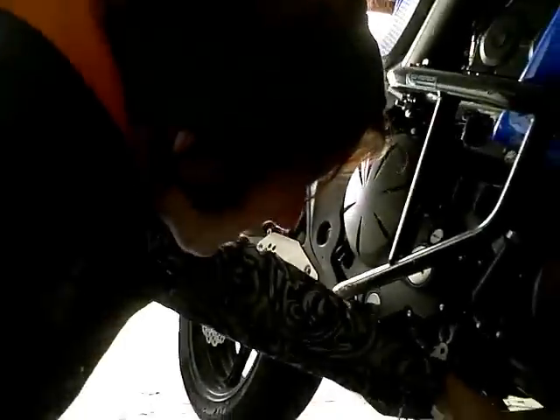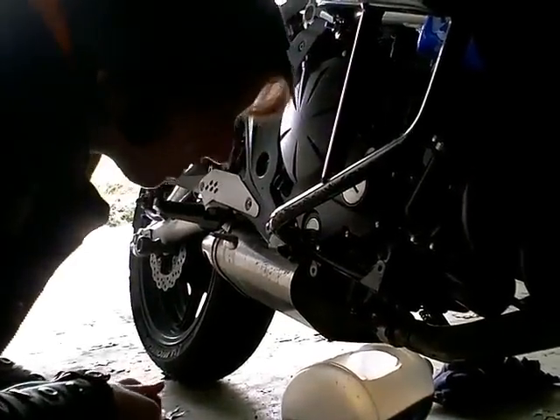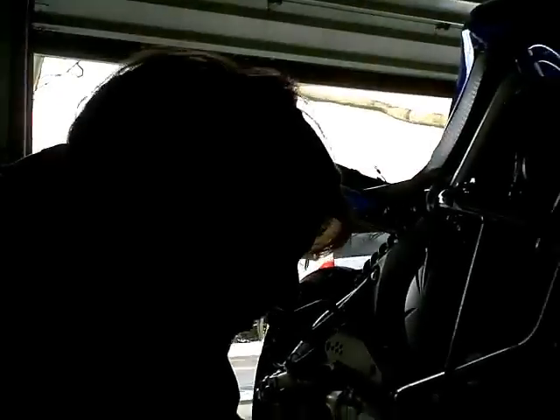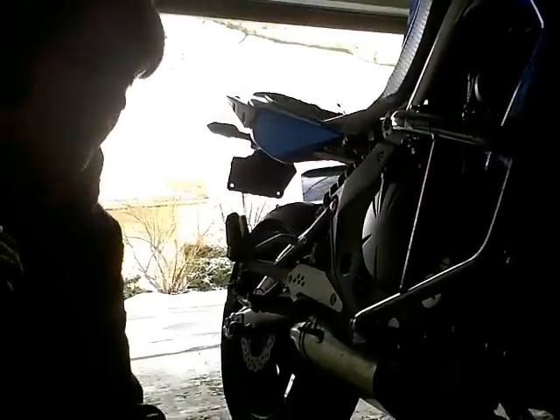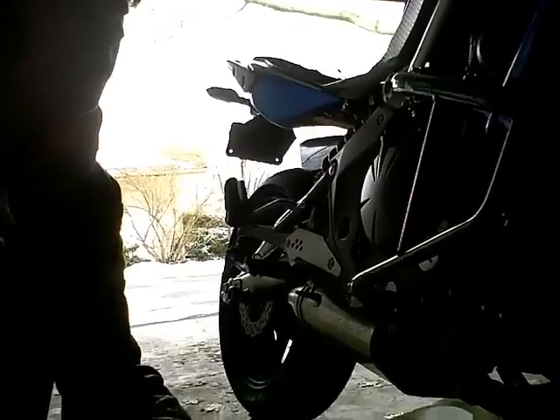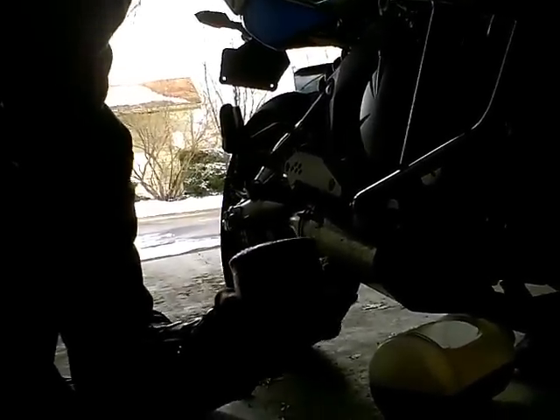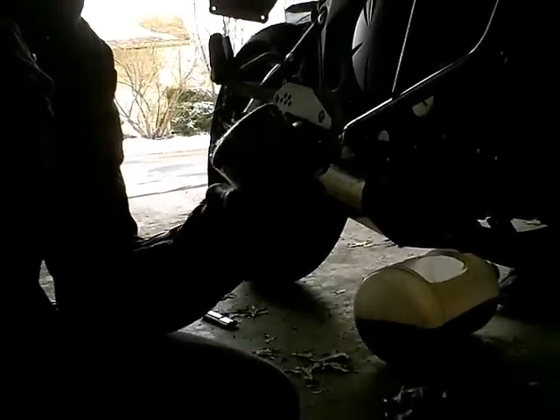For changing this filter — all the manufacturers, Honda, Kawasaki, they almost all have one filter. The Kawasaki part number I can't remember — I think it ends in 1034. This one ends in D01. As long as we get the thread size and gasket size correct, we're probably okay. If you look on the outside, they're like identical. Suzuki's ends in X07. The gasket is probably 100% the same — all of them have an outside gasket. I bet the threads are the same too.